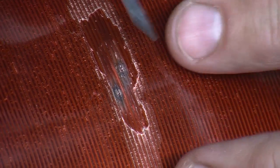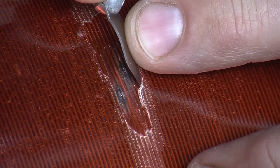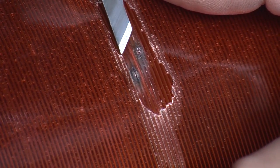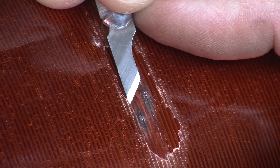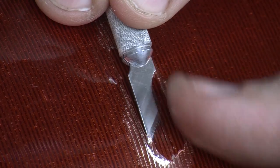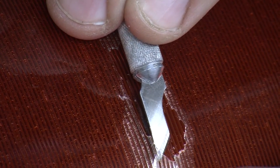So what I'm doing is very gingerly lifting the coating and tearing it away. Depending on how your coil is coated, this may be easy or difficult. I'm being extra careful and slow so I don't damage the wires underneath, but it's coming up fairly easily. My blade is pointed away from the copper wire so I don't nick the insulation anymore and cause another problem.